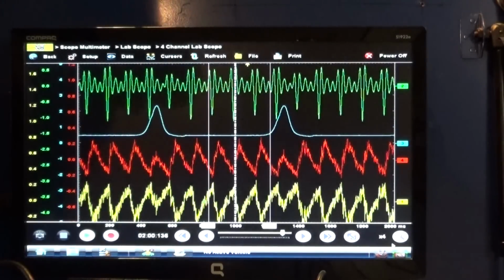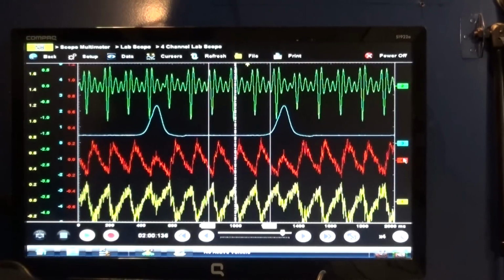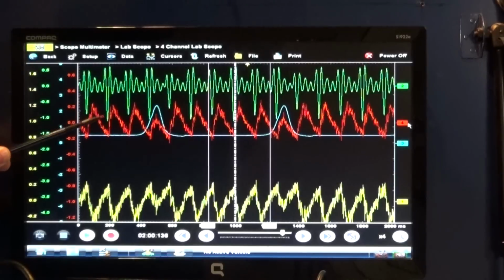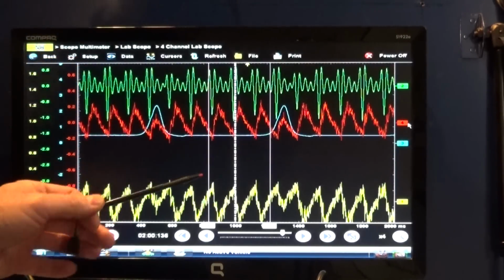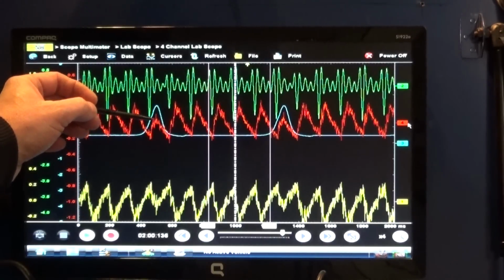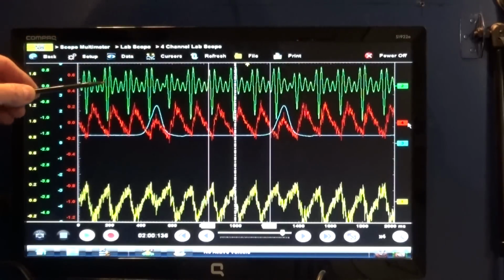Okay. And now I don't have my trigger from cylinder number 2 anymore; I needed this channel. So basically, this is my first look sensor. Let's move the red trace. This is my current clamp. Every time a piston goes up and pushes the air out, we have a pulse taking place as the sensor senses the pulsation. Since this cylinder has less air, it pushes less air out because of the hose adapted in it. It's nice to see this: this signal is actually less compared to the other cylinders.